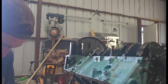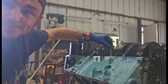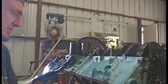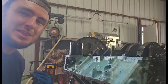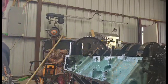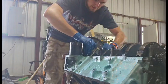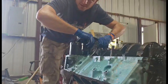So I was talking to my cousin Zach — they have my heads out of the motor, and we found out that those heads are not 882 heads. Is that a good or bad thing? It's a good thing, because the heads that they are — I believe he said they were 226s — which are a dirt track motor head. So we think I'm going to make more horsepower than what I originally was thinking. We were thinking between 300 and 350, but now it's going to be more towards 350 to 375. Maybe. Which is fine — the more the better for this thing. You gotta spin 35s, so probably a good thing.